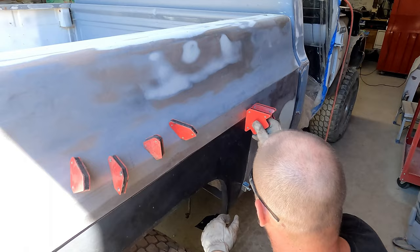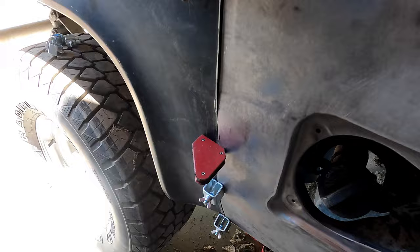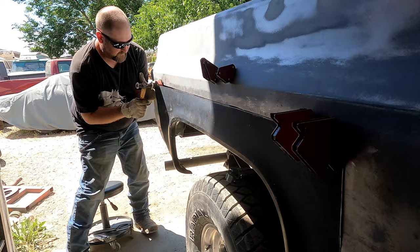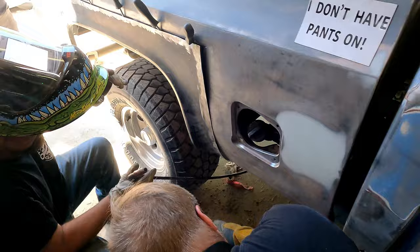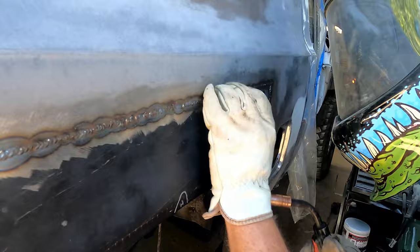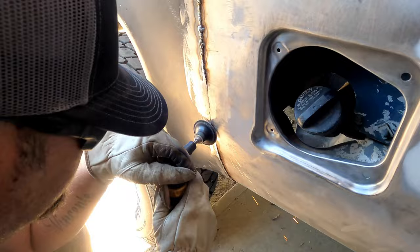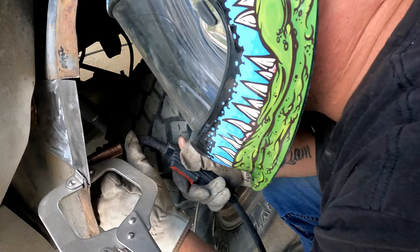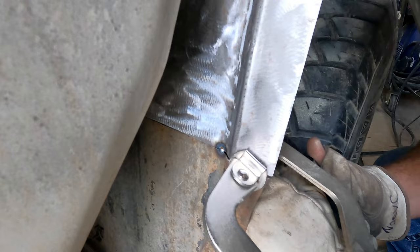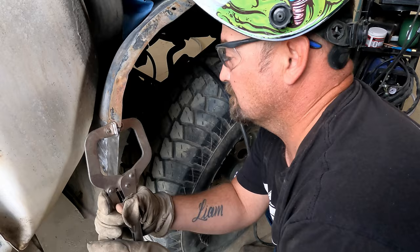Sometimes we use strong magnets to hold the panel in place — unlike fasteners, they're easy to remove and you can pull the panel off quickly to adjust it and fit it back. The first tack weld determines where the panel will sit, so make sure you do it right the first time or you'll have to cut the tack and start over. Welding too much in one spot will warp the panel, so go back and forth with your welds on each side. Now that the weld is completed we can smooth it down and get ready for body filler. We also have a patch for the front passenger side wheel well — clamping it in, tacking it, grinding it down for a perfect fit. Remember: alternate your welds so you don't warp the panel.